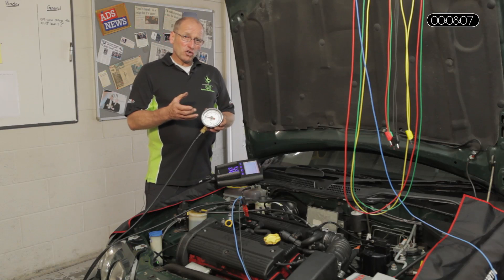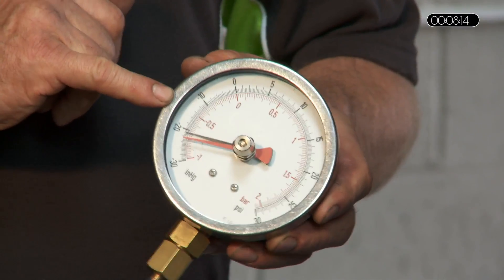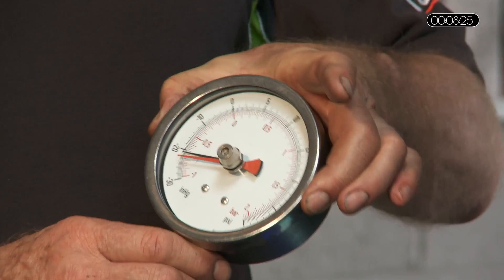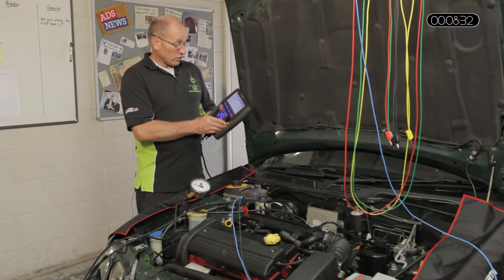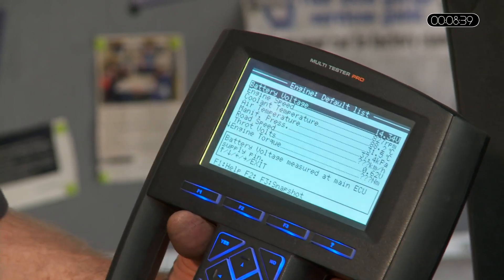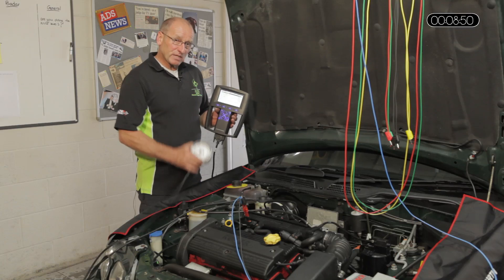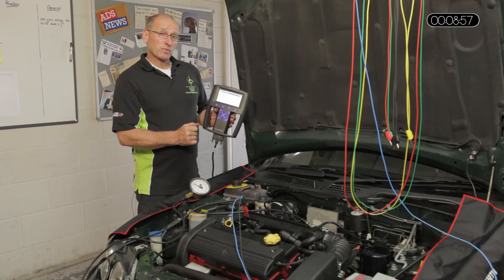With the introduction of heat or increased engine speed, if there's tappet jacking or anything like that, there will be a reaction on this gauge instantly. It has a long hose attached, so this gauge can actually be brought into the vehicle, driven down the road, and measurements or observations made from its 4-inch clock face. Happy with the gauge. I expect to see somewhere around 40 kPa serially — we're very close to that figure, so 37, nearly 38 kPa. I trust the figure. I trust the gauge. I'm happy that the plausibility and sensitivity of the MAP sensor matches the real world — this is what's actually taking place in the manifold, and the value from that pressure sensor is reporting back to the ECU with the correct value.